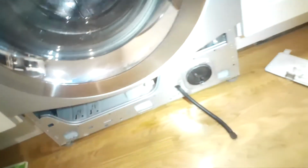I like to leave it open while I test it so I can see if there might be any leak. If you do have a leak, you probably just have to tighten up those 3 Phillips head screws that hold the motor on a little tighter. Alright, looks good. So we'll go ahead and put the lower panel back on.